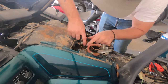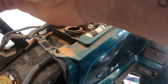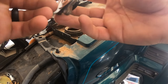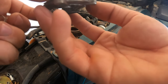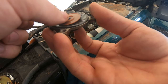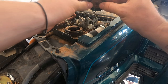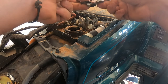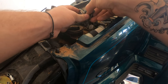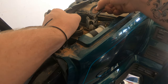If you saw part nine of the 1996 Goldwing restoration series, nothing really new is covered here. This is just a tutorial in case you're just trying to fix a leaking petcock. So you take those four JIS screws out — they kind of look like a Phillips — and then you have this two-part diaphragm, a plastic cap, and the spring. You don't want to throw away that plastic cap, the spring, or the metal piece that connects both diaphragms, because the rebuild kit normally just gives you the rubber pieces and Phillips screws.